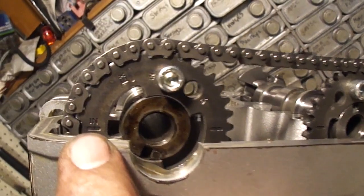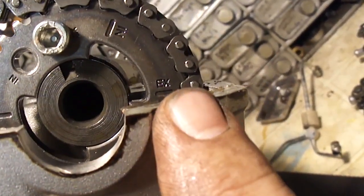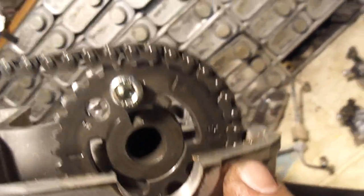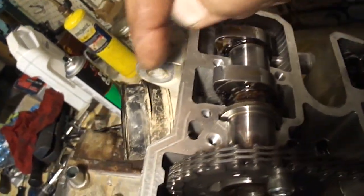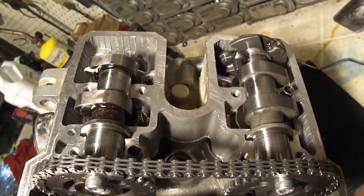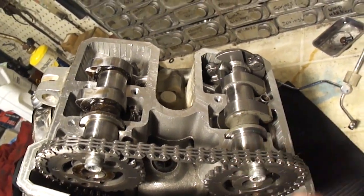This is how it should look. You should have the intake with the little IN up so you can read it, and these lines lined up with the case. On the same side with the exhaust you want the little EX up so you can read it — if it's down it's backwards — and these two lines lined up. Your exhaust cam has the decompressor on it so you know that's the exhaust. You want the exhaust lobes pointing at the exhaust port and the intake lobes pointing at the intake port, so they're away from each other. This is compression stroke top dead center — right now is where the spark has just happened and the piston is getting ready to go back down. On its way up the exhaust is going to open, so the exhaust should open first. The engine rotates this way.